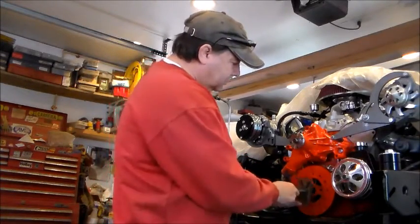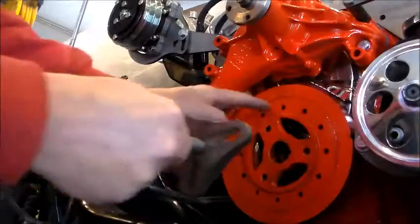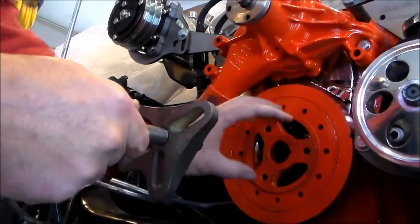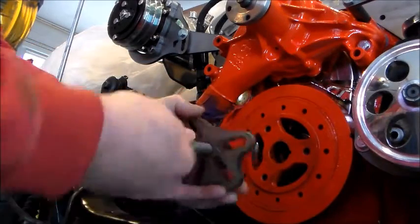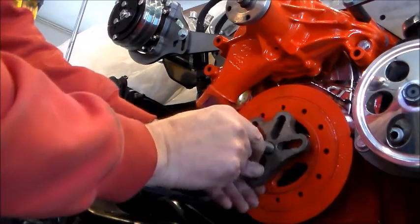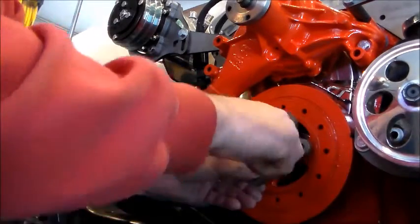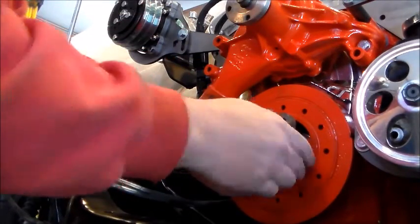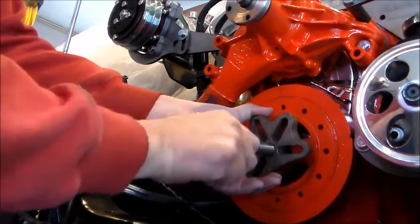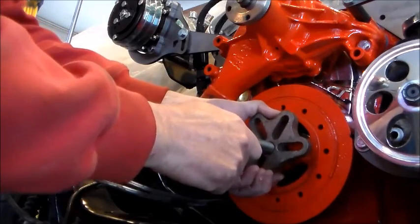It's got a nice little button so you don't damage your crankshaft. You put your bolts in and screw your center in. There are three holes in the balancer where you pull these screws on. We utilize those three holes, back this screw off, put our puller on to correspond with those, put our bolts in, screw them down, and then once all three bolts are lined up, we turn this — and as we turn this, it walks this piece back and removes the balancer.